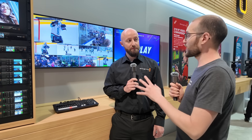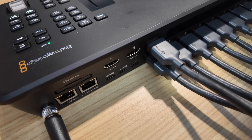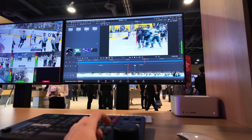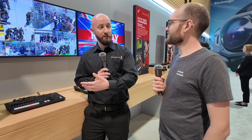One exciting thing for someone who makes graphic software is that key-fill graphics take up two of your eight inputs. The Thunderbolt feature addresses that. The primary use case we're showing here at the booth is for replay out of Resolve. The Thunderbolt interface works bi-directionally — we can send video out of the switcher into a computer for things like multi-view, but also get back two channels of key and fill into the switcher as well, using the desktop video driver.